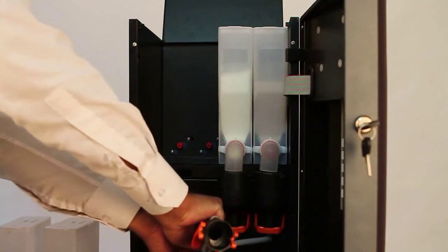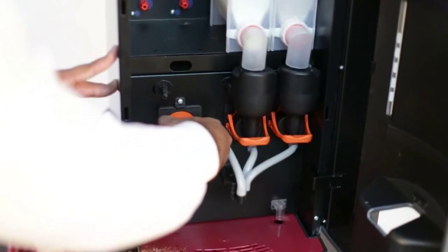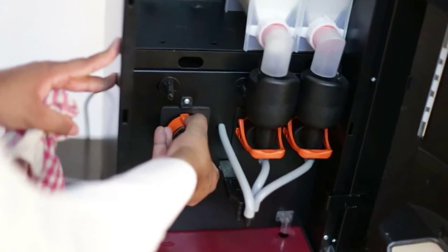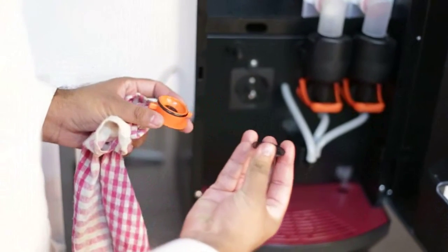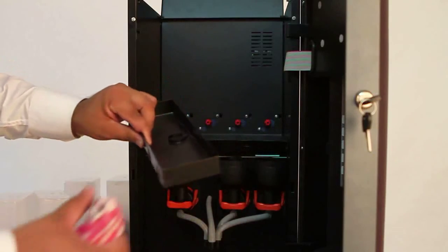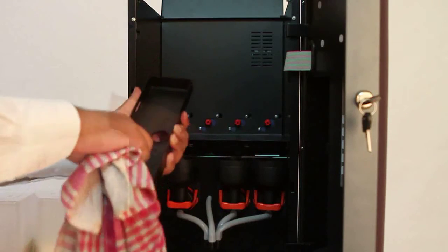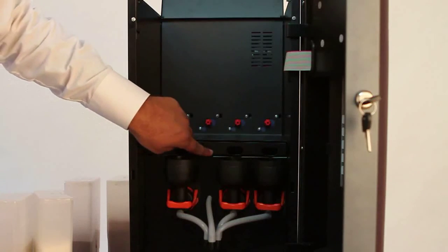Remove the silicone tube connected to the dispense outlet. For cleaning the whipper chamber, remove it by rotating it in an anti-clockwise direction and gently pull it to avoid damage to whipper motor shaft with blender and seal. After removing all funnel covers, remove the fume suction tray. Clean the inner part of the tray and then put it back, matching the hole positions of the suction hose.